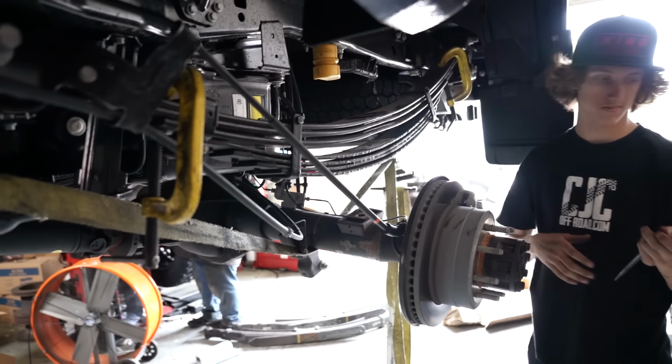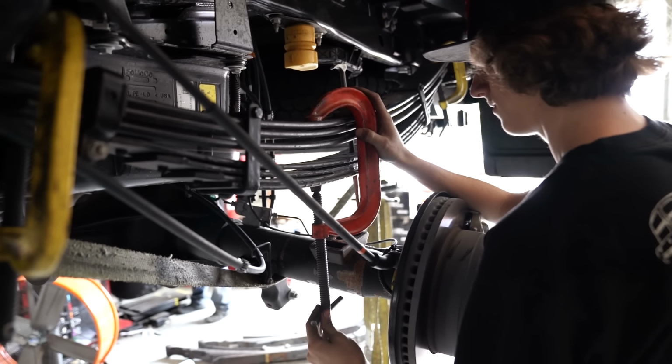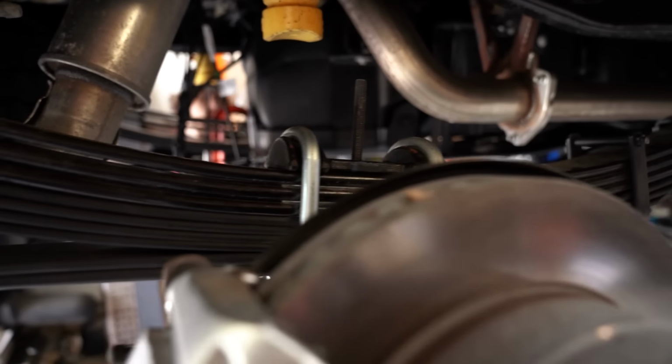Now, also in the rear, we have the Adapacks. A lot of guys ask, how do the Adapacks work, or how do they maintain towing capacity? Now, what they do is they maintain the stock F250 capacity, because you're getting rid of the thick overload leaf that's underneath, and you're combining it amongst a bunch of thinner leaves, and what that does is over dips, the springs are allowed to move more, but when weight is put on this spring, it still maintains the full capacity.